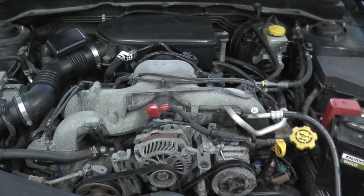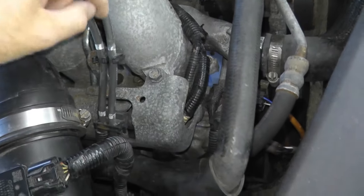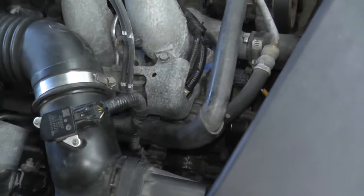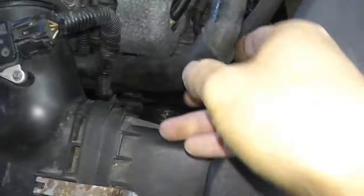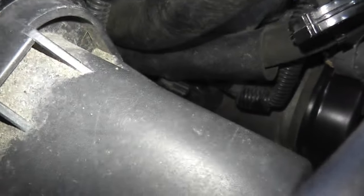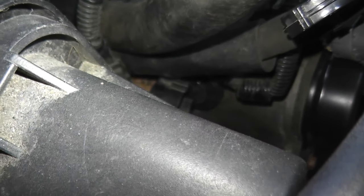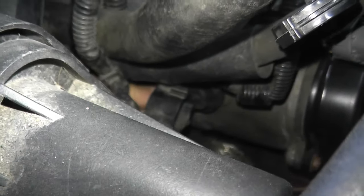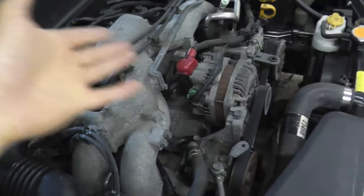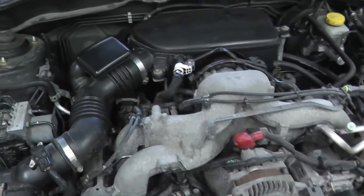What I'm going to do is start the vehicle. In my case I have P301, so that's cylinder number one. Follow the wire — it's very tight working room here in the Subaru, but you can certainly do this. Right there is the end of the spark plug wire. With the vehicle running, just pull it off and pull it back. You should hear a decrease in the RPMs — if the car shakes and shudders, that means the cylinder is firing correctly.